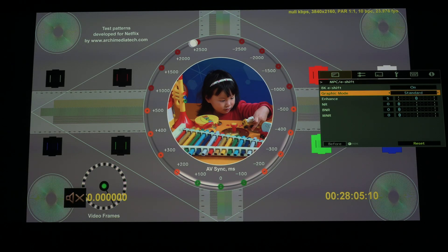Setting e-shift back — high res 2 is technically for 8K input and high res 1 is for 4K input, so high res 1 would be the technically correct setting. But on high res 1 I very much have the green cast on the outer circles and the center bars have a little green mixed in and are not neutral. On high res 2 everything goes neutral with the least amount of color cast. Anyway, I'll leave the video there and see what you guys think. Thanks.